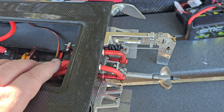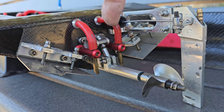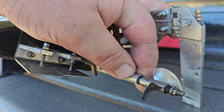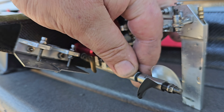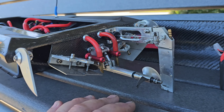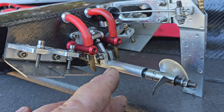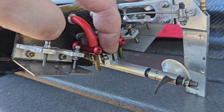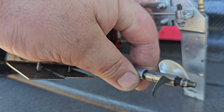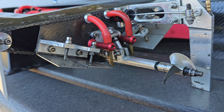Did have a couple of little glitches with that servo, so we need to check that out. I actually have an Oxydrive at home — we're going to replace the barrel. All I really need to replace is this right here. This boat's about a year and a half, two years old. I got some play in my stinger — I've been running it like this, actually got 91 the other day and my stinger is just flopping around. I've had to replace the bearings and bushings a couple of times, a couple flex cables. I actually removed the post and tried to manipulate that aluminum to close in that little eye hole — got it tight, and it lasted about a month of running, then slowly wore itself out again. So we're going to use the Oxydrive.